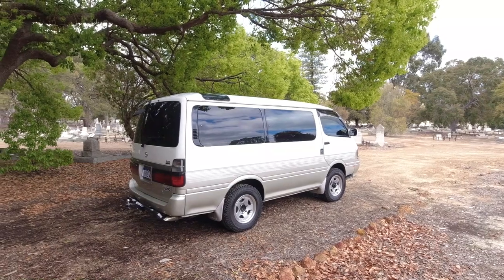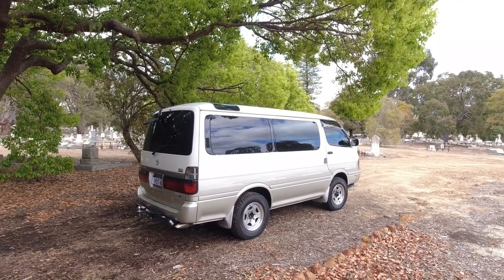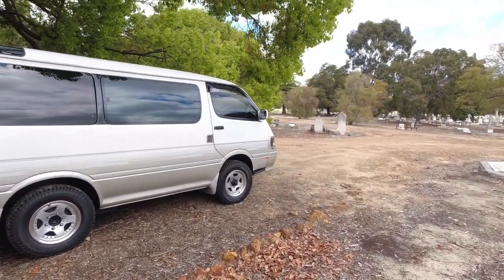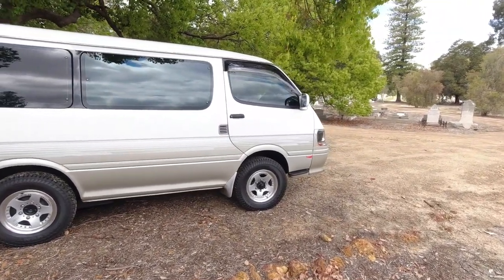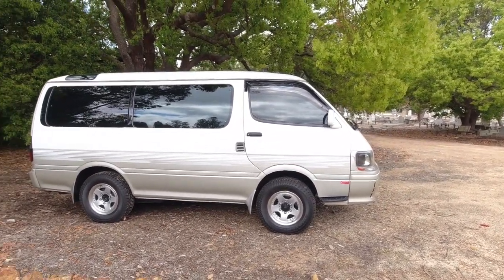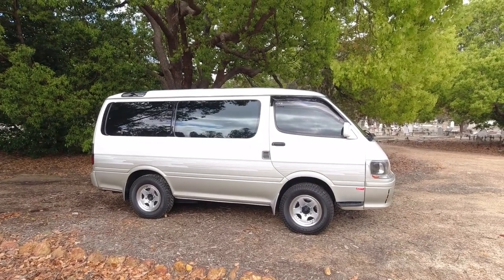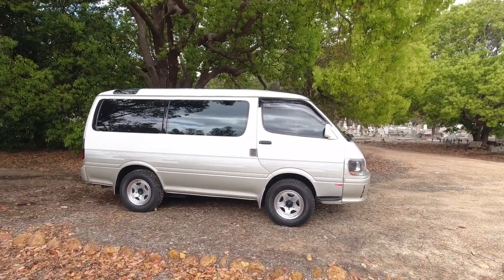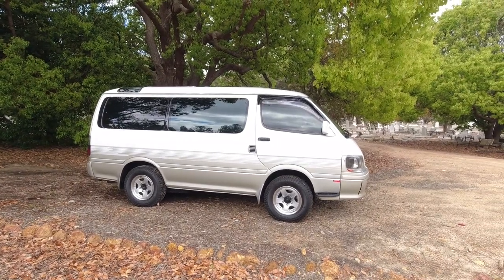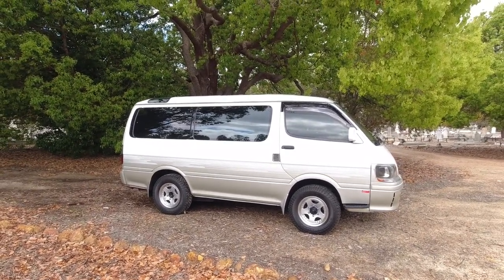So in summary, what we've just checked is under the engine cover, we've checked all the fluid levels, we've made sure that nothing is leaking, that there's nothing untoward happening there, that there's no shiny bits that would indicate work recently being done, if the owner hasn't already explained that to you. We've also checked the tyres, the brand of tyres, the brand of oil filter and fuel filter that's on the vehicle. We've checked the air filter condition and the air filter housing's condition. Is it rusty? Is the air filter soggy at the bottom and rusting around the bottom, which would indicate that the car's been in deep water or muddy water? We've had a really good look at the radiators, and the front, the air conditioning condenser, and making sure that the plastic shroud and the underbody protective panels are in place, that there's no wetness underneath the engine, underneath the gearbox or around the bell housing.